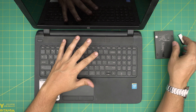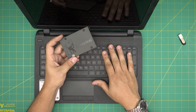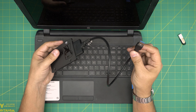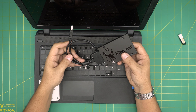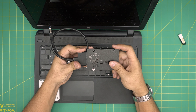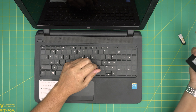For those who don't want to do a fresh installation and want to keep everything, there's another way — but you have to get an SSD that is bigger than your current hard drive. If you have a 500 gig mechanical drive, you need to get a 1 terabyte SSD. Then you can buy a SATA-to-USB adapter, plug it into your laptop, download a cloning program called Macrium Reflect, and clone your mechanical drive to the SSD. I don't recommend this because it lowers performance a little, and a clean installation is much more preferable than cloning.